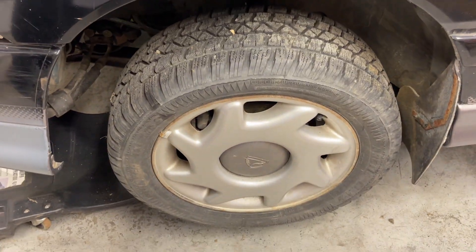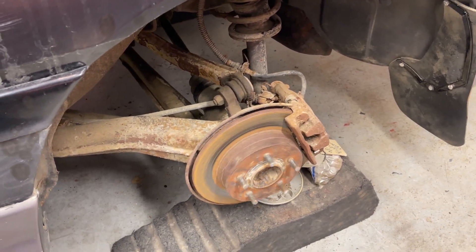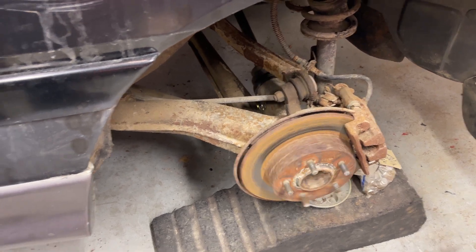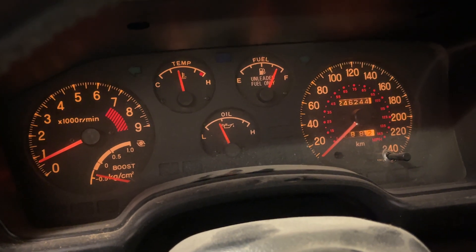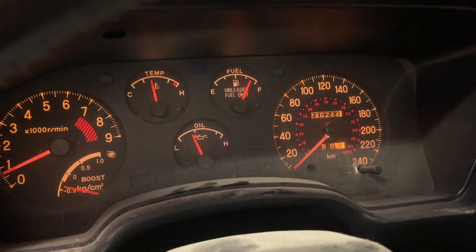Essentially, that one just needs some help along — it's trying. You can see the rotor is trying to polish itself off a little bit. I don't know if I'll replace the rotors or not; we'll see how well it can clean off. I haven't looked at the fronts yet either. We're pretty much almost up to operating temperature — the thermostat hasn't cut in yet, but it soon will. I might wait for the fans to cut in, then we'll shut it off and start our testing.